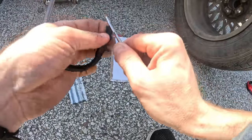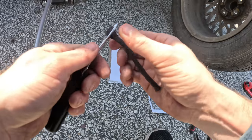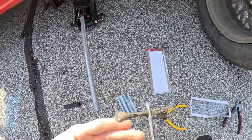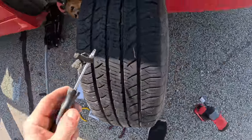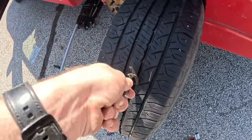You stick your little glue strand inside the hole. It's hard because it's got glue on it. Once you've got this threaded about halfway through, we're going to stab it in there which is going to take these two sides, bend them backward making this twice as thick, and then pull out really quickly — there's like a knife on the edge so it'll cut it in half. It'll make more sense when I show you. Now we're going to take this and just jam it in there.